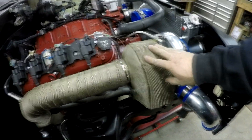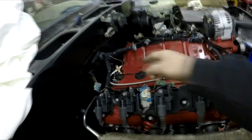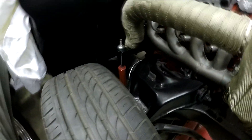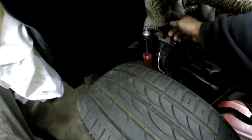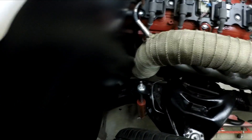All installed with the turbo blanket - there's the O2 sensor which will get plugged in once I run the wires through. It goes down there with decent clearance - it's tight but they move together. I'm thinking about putting some kind of limiting strap on the engine so it doesn't twist over as much when you rev it up or accelerate, because it might hit the frame. But there is clearance - it's just tight, which is what you expect with three-and-a-half-inch exhaust going through that area.